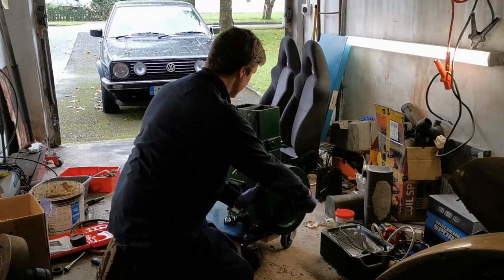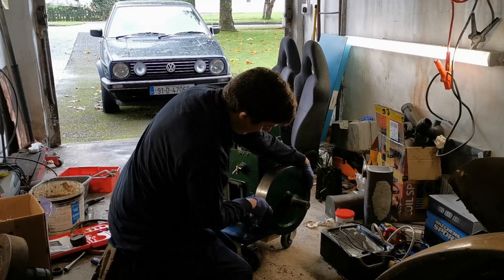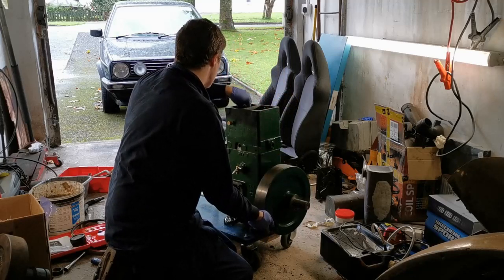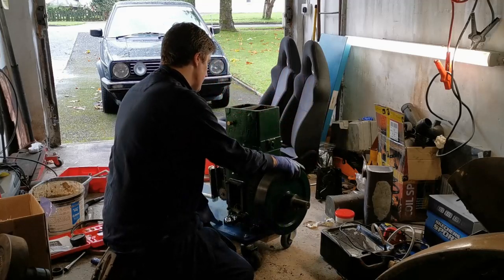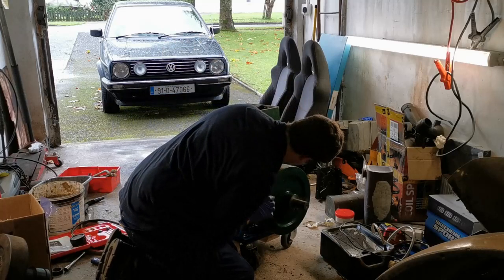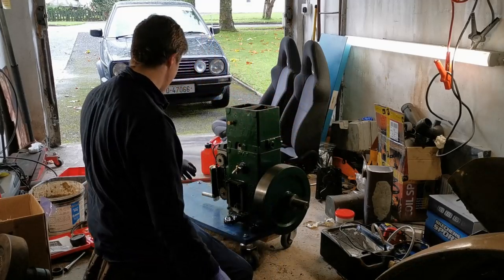You can see now, because the two rockers are moving, that's the top dead center at the end of the exhaust stroke and the beginning of the inlet stroke. So we want the top of the compression stroke. So we'll spin it around 360 degrees. Now you turn it and you find both the valves are slack, and we are at top dead center now. So the engine turns this way, okay? Clockwise, so 20 degrees before top dead center would be about there, I suppose. Years makes no bloody difference anyway.